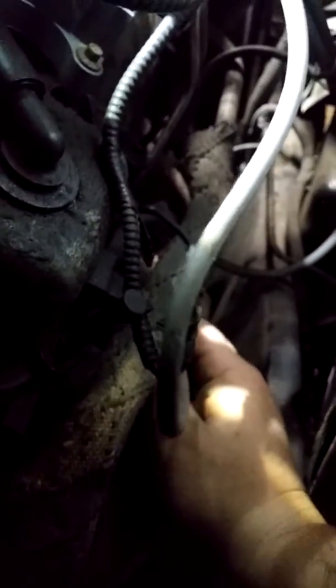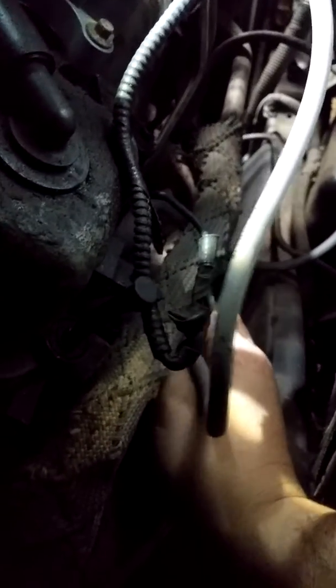And one of these ratchets here is really handy to have in this particular situation. You just once again take your actual spark plug wire, get it over top of the plug, and get a good position on it, and when you push it in place, you'll feel it click. That's because the spring inside this wire is wrapping around the spark plug like it is supposed to be.